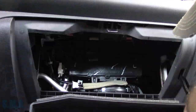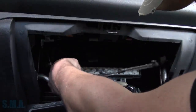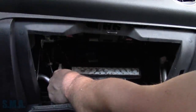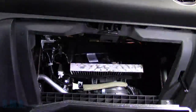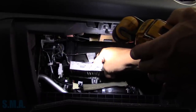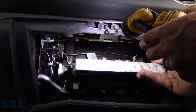So let the glove box hang. We'll come up in here and pop this little guy off. Do not remove filter while the blower is operating. Whoa — she's one crusty peg in here. We're gonna pull out nice and slow because we don't want to drop stuff in the motor. Better get out the old knife. Oh boy, I better get a light. She's wadded up tight on top. See if we can push it down so it stays in the filter and doesn't drop in the blower housing. I don't think that's gonna happen personally. Hopefully a freaking snake doesn't jump out and get us. No, we're gonna have to give this one some sucky sucky because there's no way all this is staying on the filter.